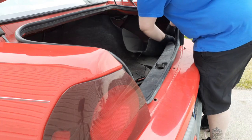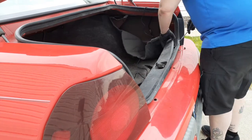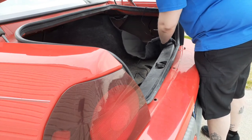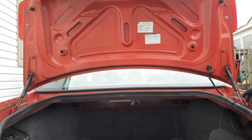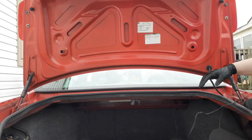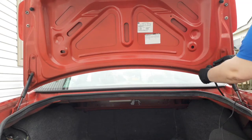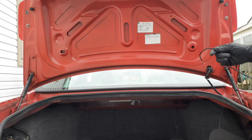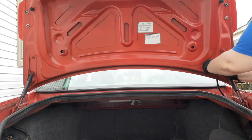I'm going to pop this panel up a little bit, tuck the wire under there, and then slap it back down. Now we can start feeding the other end of our wire up through the deck lid, up to the reverse lights. We're going to pull out this other grommet on the other side of the wire loom and just stuff it through, pulling it out at another point in the deck lid.